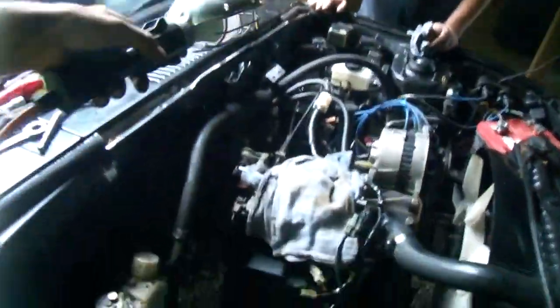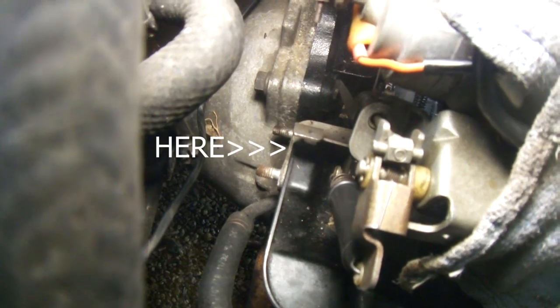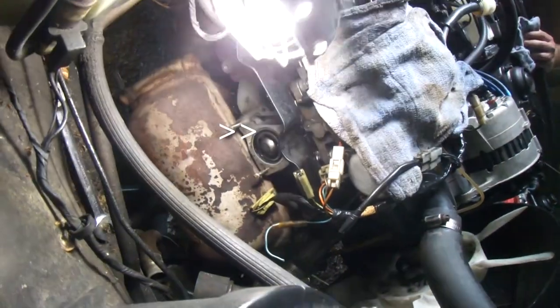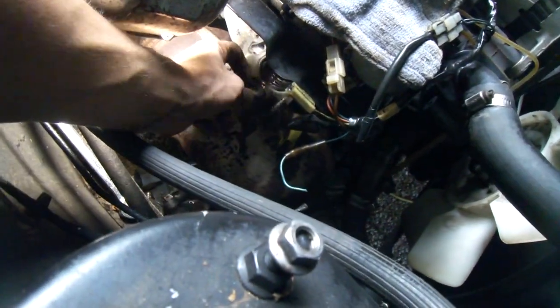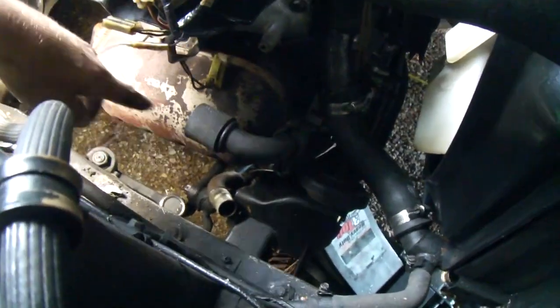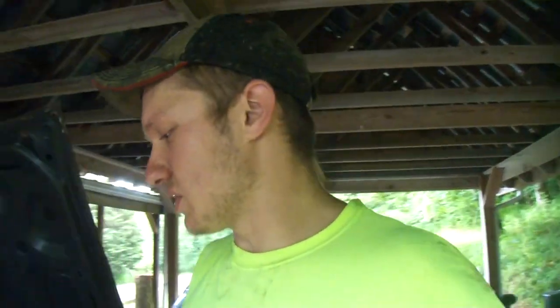That boat anchor is the thermal reactor. Above that you have an exhaust connection on the back of your intake manifold. Right there — those two studs sticking out — remove that. There's a pipe that goes down to the exhaust from there, and then right here you can see there's a spring-loaded looking Star Trek device. That's going to fall out right here — this is all part of the BAC. That stuff goes down in that hole, you've got to remove that.